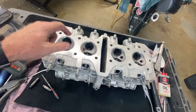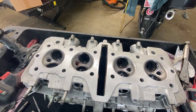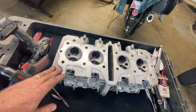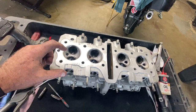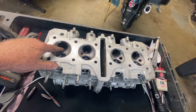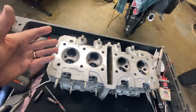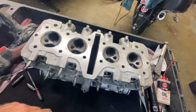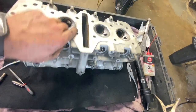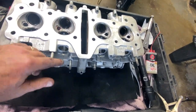I used a spring gauge and made some measurements — they seem to be correct as far as size goes. That spring gauge is a little funky; it's out of a Lufkin set I picked up at a garage sale and it's difficult to work with since it's so short. I'm not necessarily going to rely on it. It'll all depend on the feel of the new ones going in. I don't have them yet so I can't mic them up to see what the comparison would be.